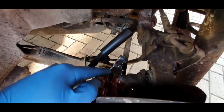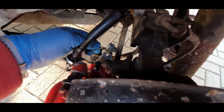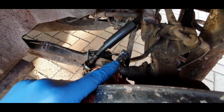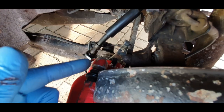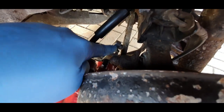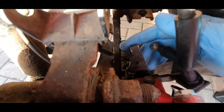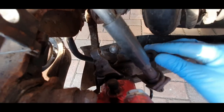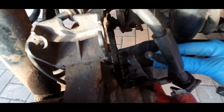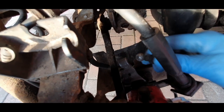As you can see, new brake mechanism — the other one was seized. This is the handbrake cable; on this side the little ball fits on it perfectly, no problem. But on the other side is where I had the issue where the cable will not reach. As you can see on this side — sorry about the light guys, the sun is shining — I can only pull it back so far because it's really tight with the new pads, and this doesn't reach the other part of the handbrake.